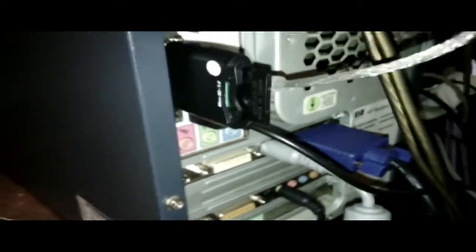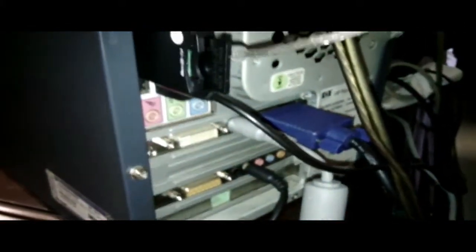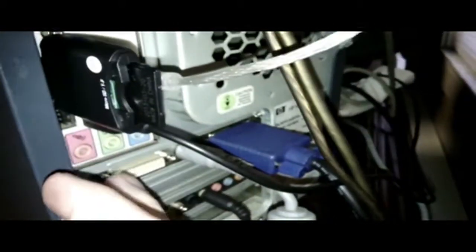A quick tip: if you ever power on your computer and you're not getting any of the strange beeps associated with a no RAM or no processor issue, but you're not getting any video signal either — if you have two video ports on your computer, there's a very quick test you can do to see if your video card is at fault without even opening up the side. Unplug the monitor from whatever port it's on, which is usually the video card, and plug it into the actual onboard video port. If you have signal coming out that way, that tells you your video card is what's at fault and that's the only thing that needs to be replaced.